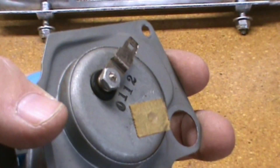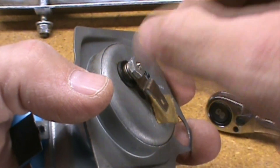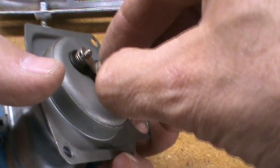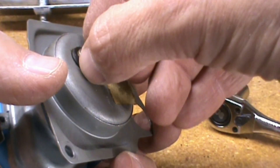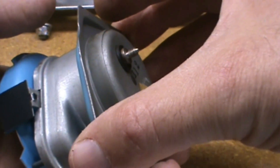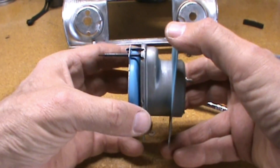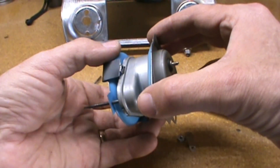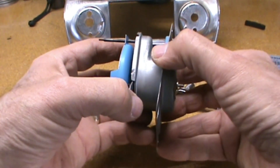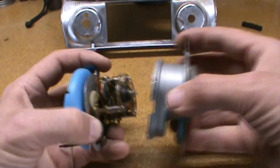In order to remove the electrical connection in the back of the clock, you're going to need a 5/16th wrench, either socket or whatever your favorite wrench is. Take that apart and note the order of assembly as you take it apart. You've got the nut first, then the electrical connection, then a tooth lock washer on the inside. And then it comes apart - you can do it very gently.